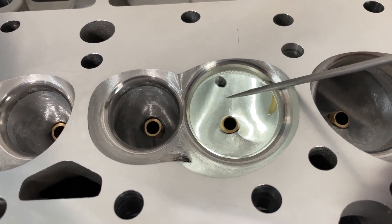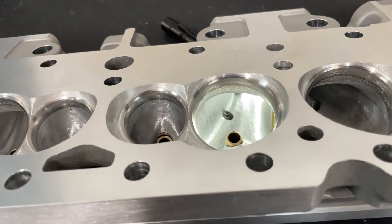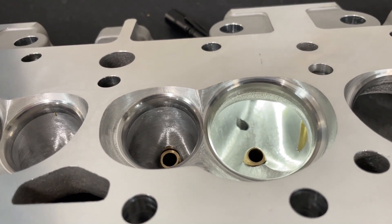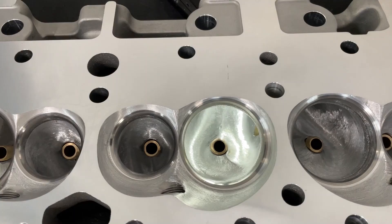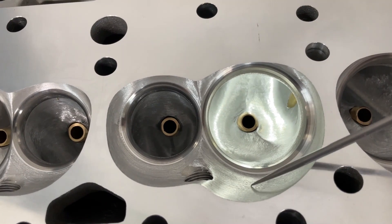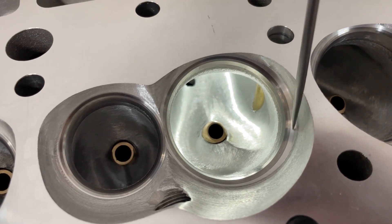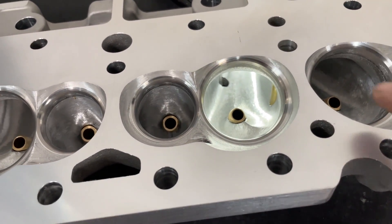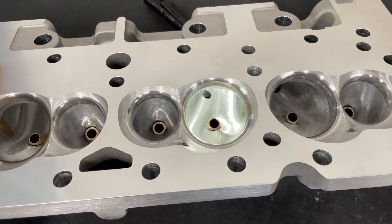The reason why is because you have to slow the air to make the turn over the short side. The short side did get laid back, as you can tell, and it also got widened quite a bit. What you're seeing there is the apex, which when I flip to the other view you can see that. It definitely got bigger, more pronounced, with nice radii. The chamber got a little bit of work too — there was a step left on the exhaust from the previous video, and that got removed.